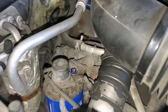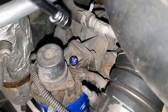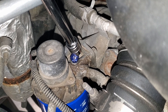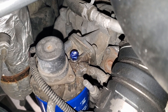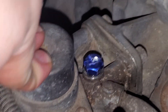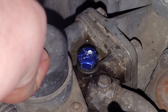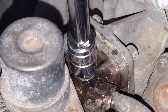After installing the new fuel filter, you want to bleed the air out. This is the plunger and this is the bleeder cap screw. If you have a plastic bleeder cap screw, be very careful — those are prone to break. I have an aluminum one that takes a 13 millimeter socket. Go ahead and unscrew it just enough where you can see fuel. As you hit the plunger, you can hear the air coming out — see those bubbles? Go ahead and tighten that back up.